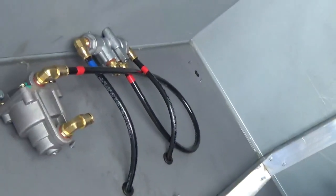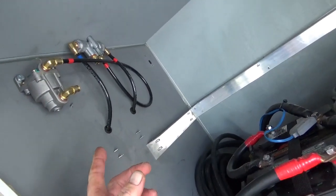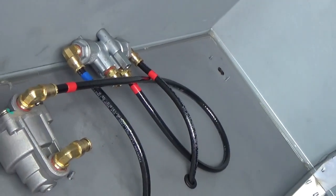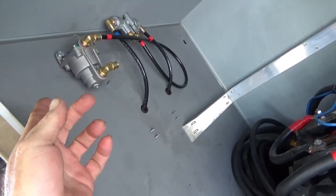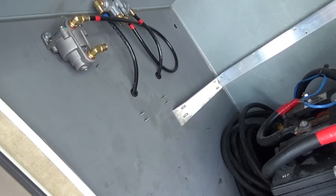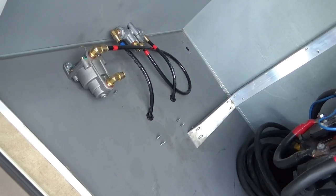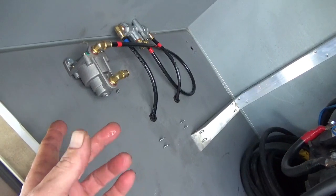And I'm letting — is that coming from here? Yep — so it's going through there. What does that valve do? The one valve on the back upper controls the brakes. When you step on the pedal and actuate, it'll make the brake actuator happen. And this one controls the pressure for the tank, which has to be 90 pounds for the Kodiak disc brakes. If I had drum brakes, I wouldn't need that valve right there.